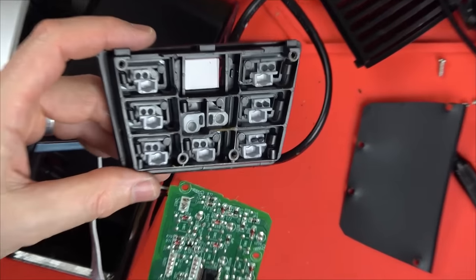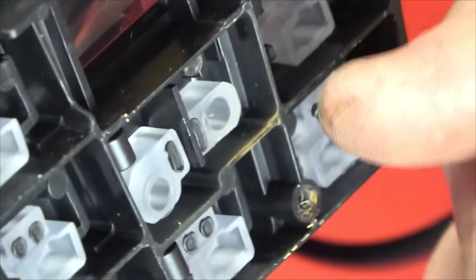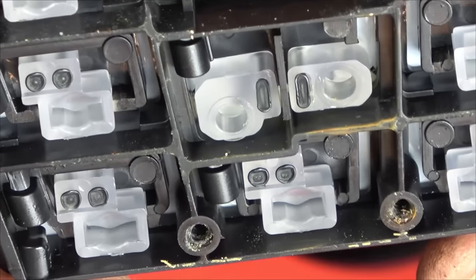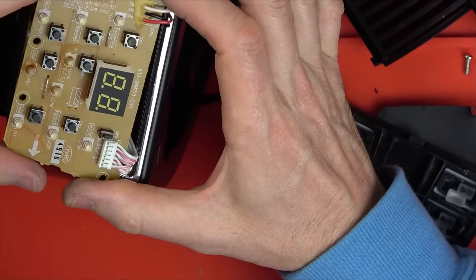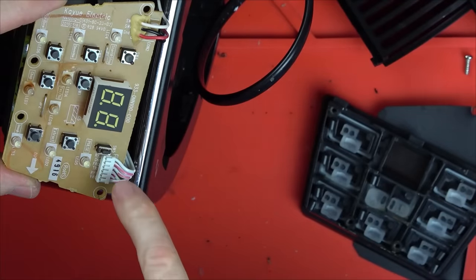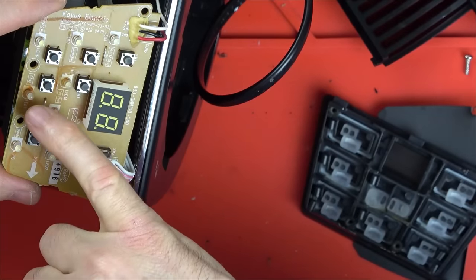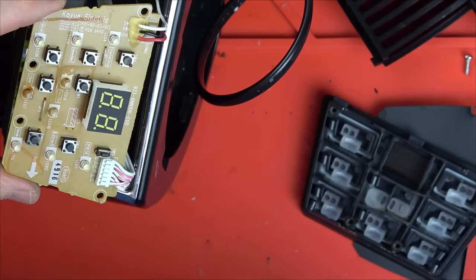You can see the rust just here and here as well. Let's flip the board over and see what we've got. Yeah, look - there's water damage there, and maybe a bit of water damage there as well. I wonder if it's taking on a kind of negative from one component to another - if this was corroded here, maybe the path stopped and that's why these two lights are not working and this light here is not working. Interesting.